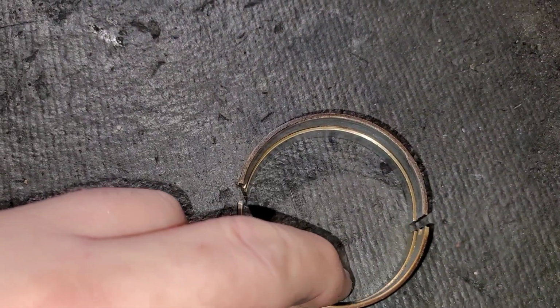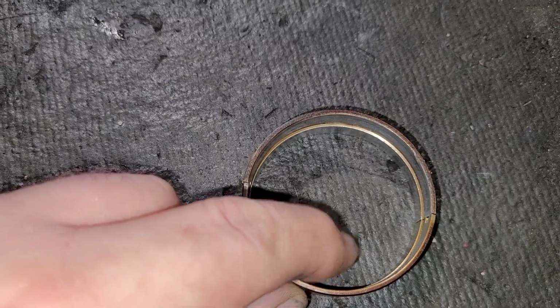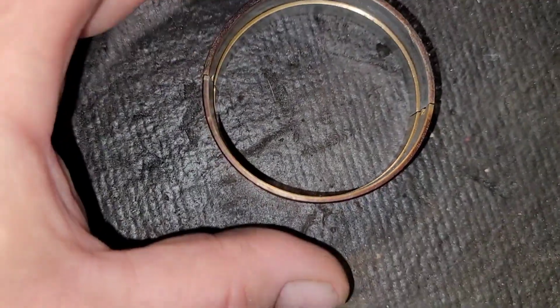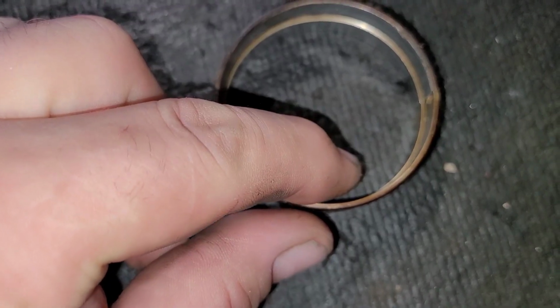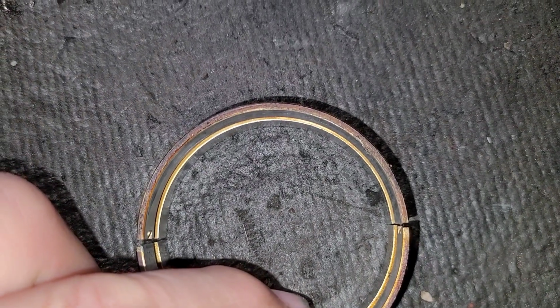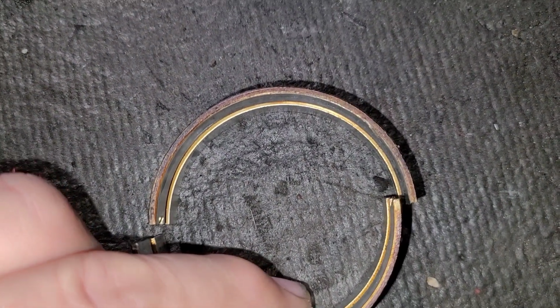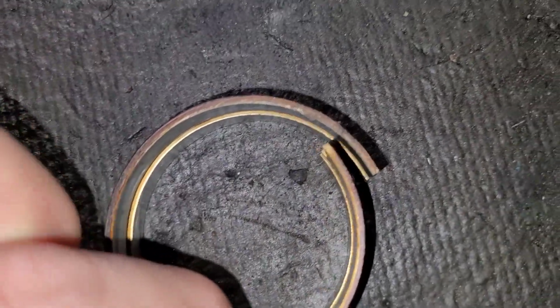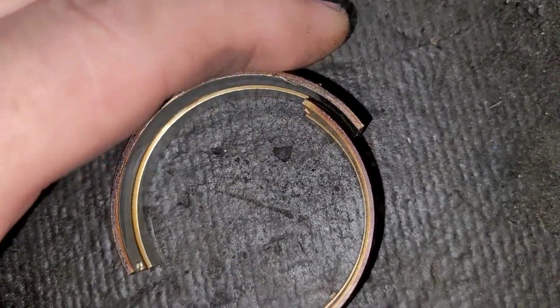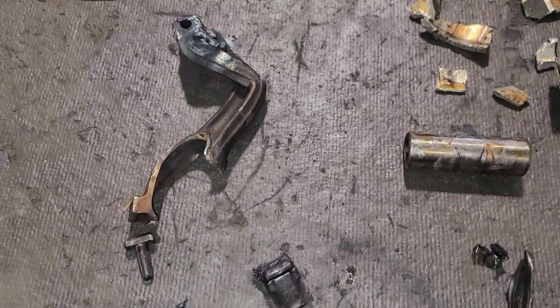Now, it probably stacked the bearing. What does stacking the bearing mean? Now, the bearing sits like this in its respective place. And what happens is, if it gets stacked, if there gets enough wear in between, this thing will actually come free, shift, and then do this. Now, as you can see, the amount of clearance it takes up is astronomical. So that happens, it wedges in place, and you get this kind of a disaster.